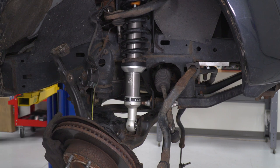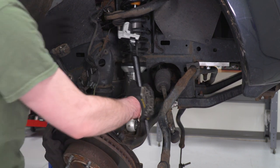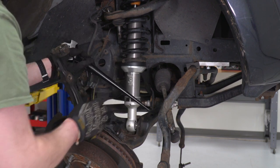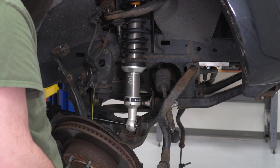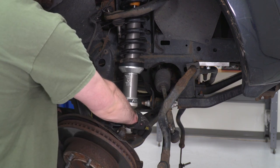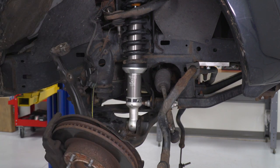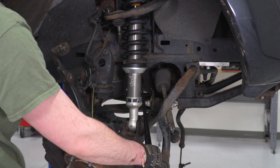So what I'm gonna do, this guy right here, called a spud wrench. It's basically an adjustable. It's also got a hammer on there, but at the bottom it has an alignment dowel. This is like an iron worker's tool, but it comes in handy for stuff like this. I'm just going to give it a small turn. There we go. Lines up really, really easily. Highly recommend having something like this on hand.